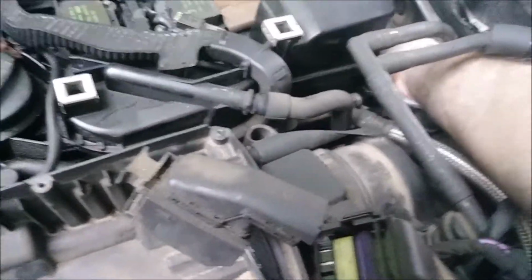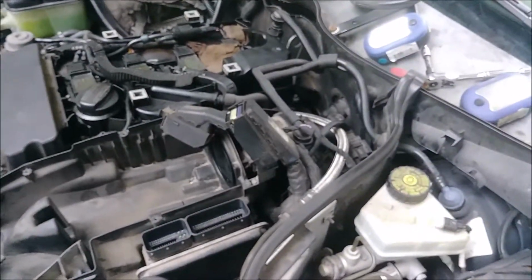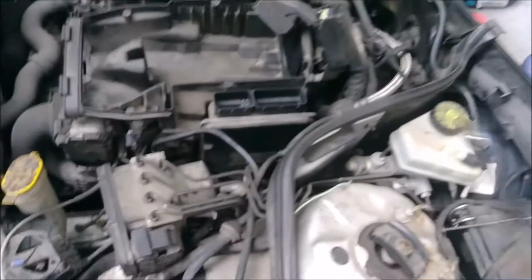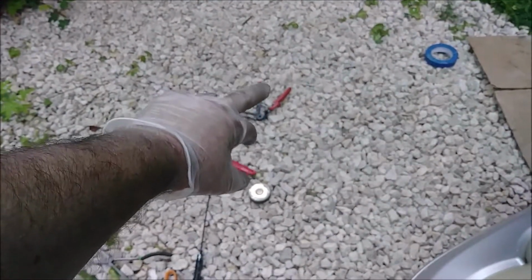But you're probably also going to need, in order to get to the thing that's holding the crank sensor in, that Torx. And I may have misspoke just now. This is the 10. E10. One 1/4 inch, and the one in the crank sensor is an E8 1/4 inch. So you will have to buy that specialty tool kit with those bits. Along with that, you're going to get this band clamp off.